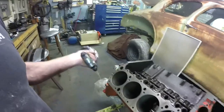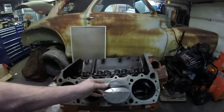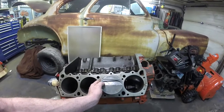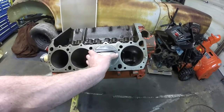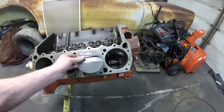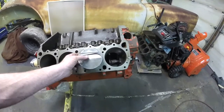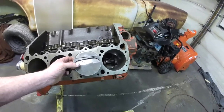This is piston number four, so it's going to sit right in here. You can see the high side here and the low side here — this is the exhaust valve. The exhaust valve is smaller than the intake valve and the piston is compensated for that. These are high-compression pistons and you need these eyebrows, or cut-ins, for clearance for high-lift cams.